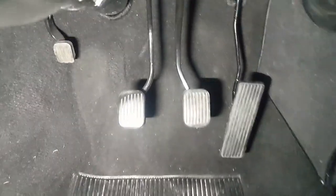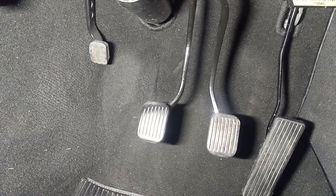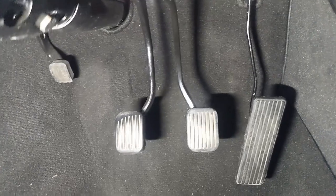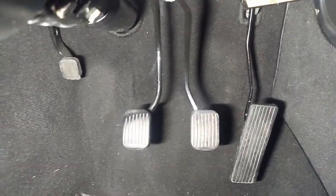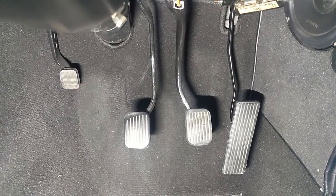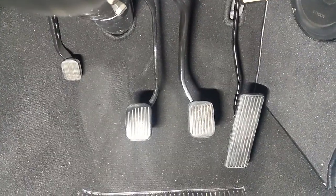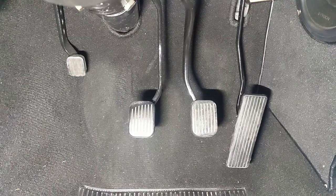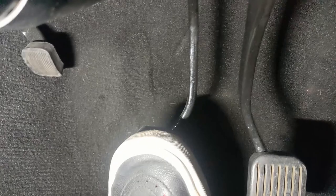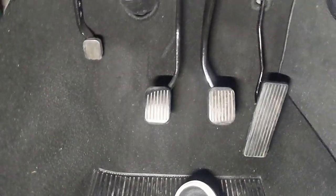Without needing harnesses or a racing seat — most modern cars come with that and Toranas don't. I've probably brought the floor section up maybe 40 millimeters, I can't exactly remember — I did it years ago. I just put the standard carpet, brand new nox carpet, straight over it and it seems to fit fine; it doesn't really stand out. I just wanted it to work better. From the driving I've done so far, it's a good improvement. I'd recommend both of these things — the throttle pedal mod is free, the dead pedal is free too, just a bit more work. If you're putting the car on a rotisserie it's a no-brainer. Just make sure it doesn't get in the way and your clutch pedal can still go down next to it — otherwise it's super subtle.